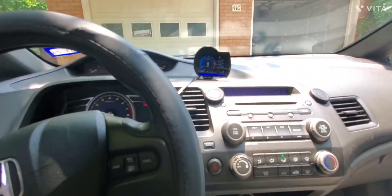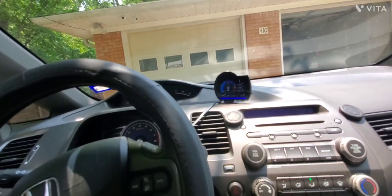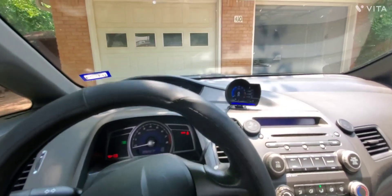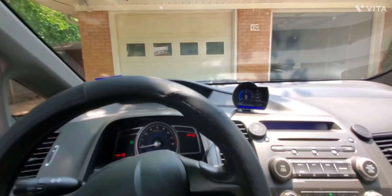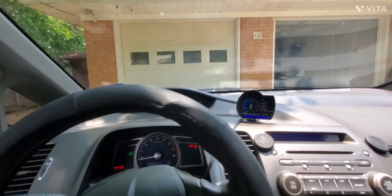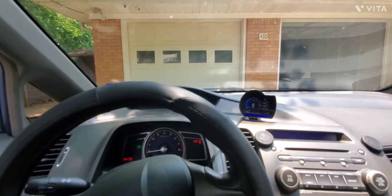Those are all things that keep your battery charged whether your ELD is working or not. It's not ideal — you want to see 14 and forget about it — but I like having this gauge and checking it. On a 60-mile trip I probably glance at it every mile, just to make sure my parameters are right, my engine's not overheating, and the block's not going to crack.